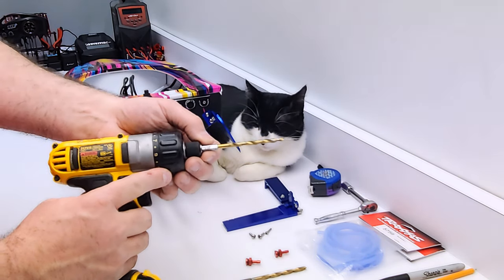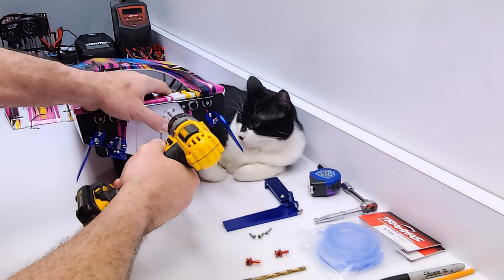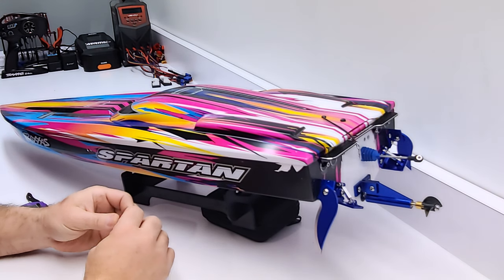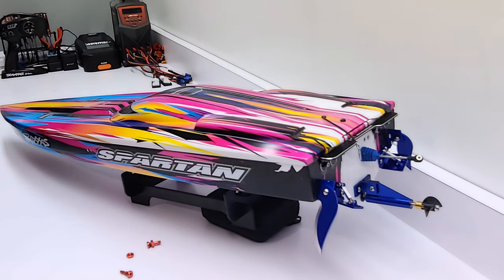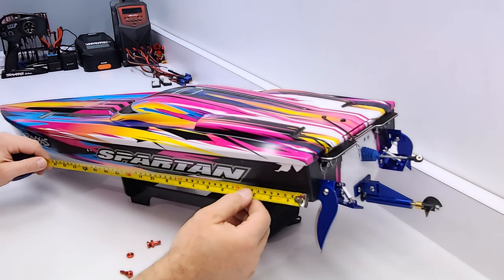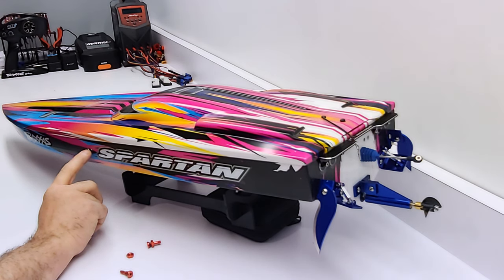So we've got our 3/16ths drill bit installed, go ahead and get that drilled. Before we go install the water lines, we're going to go ahead and install these fittings here. Just so you know, this here is a 10 millimeter nut. You're going to need a tape measure. Here's the factory hole where the water line came out. The best way to measure this is to come off the back end here — we are coming up at 16 and 5/8ths of an inch to the center of this hole.